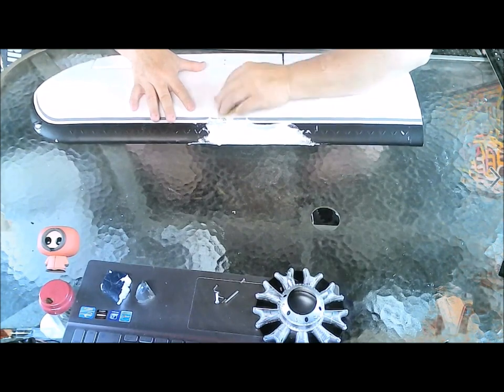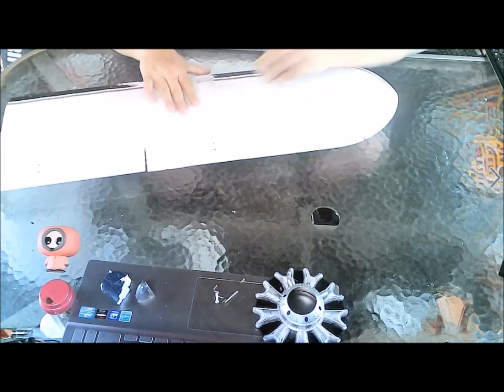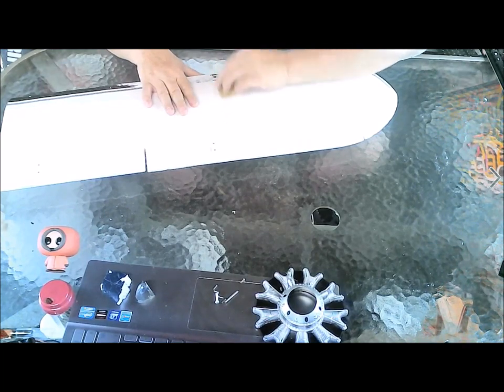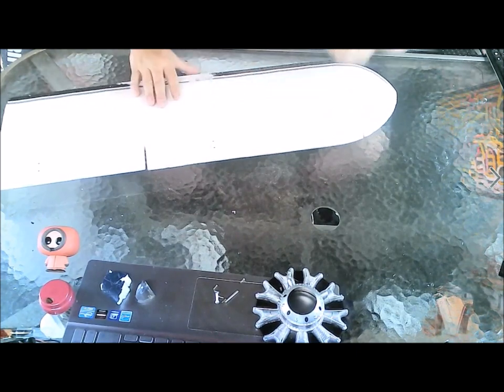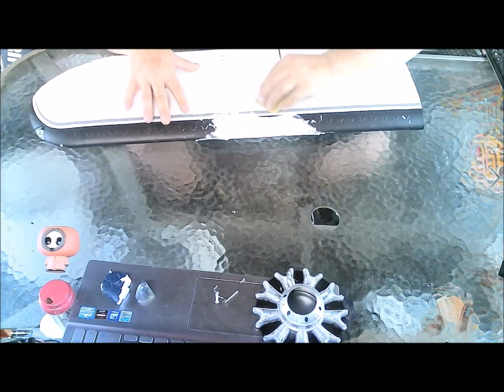And you just sand it until you're satisfied with it. I'm not going to try to make this perfect. There's other hangar rash on this wing I'm not going to fix. I'm just doing this to demonstrate how to fix it when you steam something out, and what you do to get it looking good again. I need some window cleaner, Windex or something, just to clean off the foam. And my steamer actually steamed over here a little bit too, so we'll just smooth that back out a little bit.